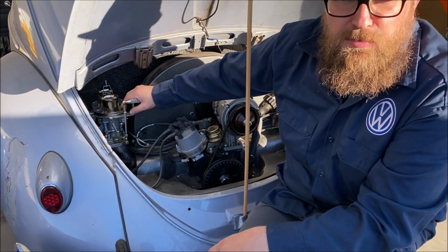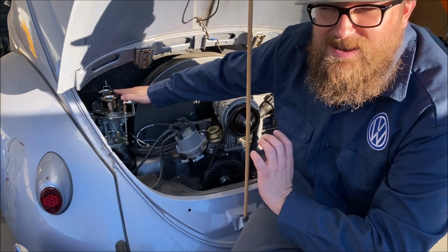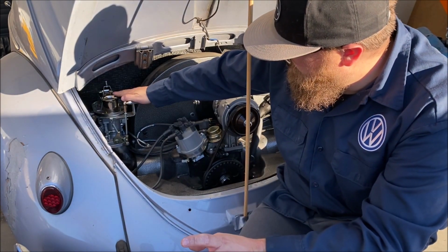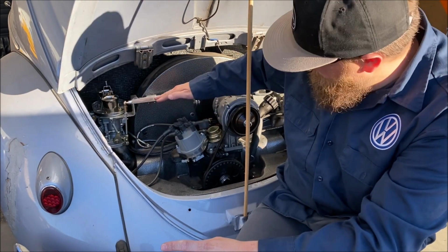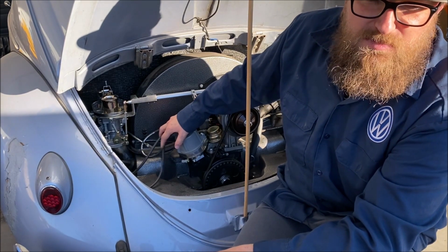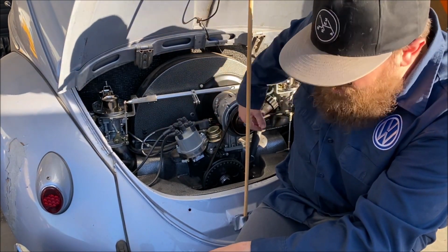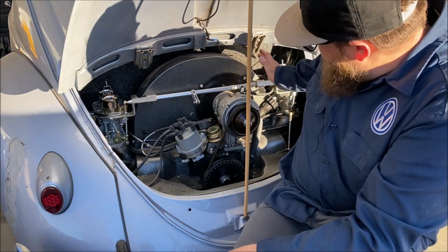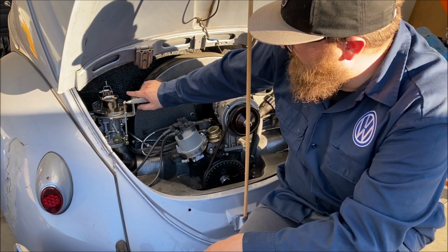Now, the driver's side carburetor. Any of the adjustment screws on that carburetor had no effect on how the engine ran. Now, I also know that it was getting spark to those cylinders. I pulled the wires, heard the spark jumping away. If you pulled the wires to the passenger side, the car immediately died. So the only thing keeping the engine running is the 2 cylinders on the passenger side.